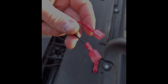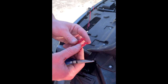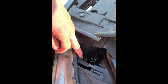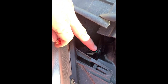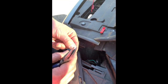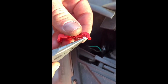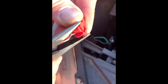Now you're going to get your two other wire connectors, and this is what's going to actually bite into the existing wire. This is the parking light wire here. Take some needle nose pliers, pull this tape back a little bit to give you some extra room to work with. You can see right there — that's where you want the wire to go. Once you put the wire in, close it, then take your needle nose pliers and crimp it down, and you're going to hear a click.